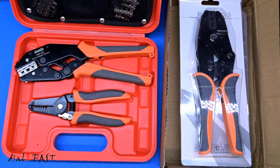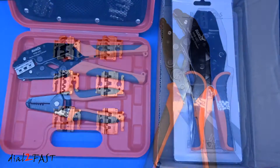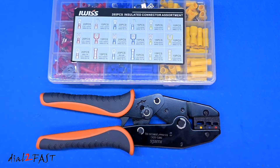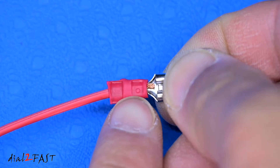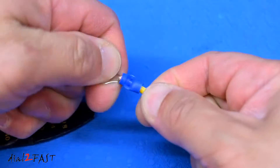The one on the left comes with six different dies. With this tool, you can change out the die to whichever one you need. The crimp tool on the right is strictly for insulated terminals, and these insulated terminals are commonly used in many automotive installs. It's important you use good quality tools for this — this will make a big difference between a good solid crimp on a connector versus one that might fail and the wire can fall out.